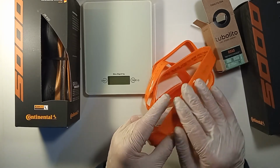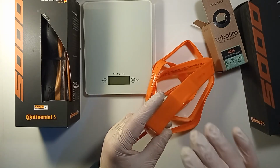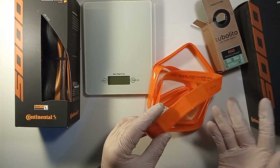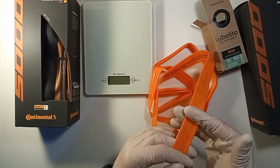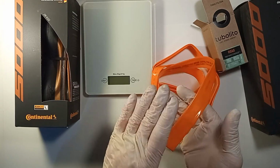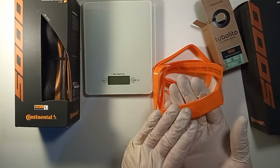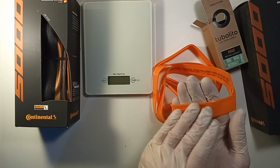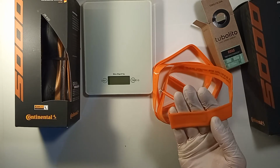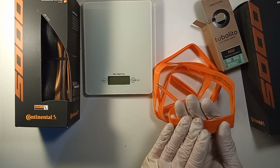And then with everything really carefully put together, I inflate the tire to the max pressure I can, let's say 80 or 90 psi. And what it does is it cramps together the inner tube and the glue and the old tube I'm using as a patch. And I found it works like a charm. So it works really good.